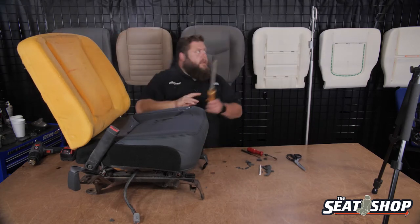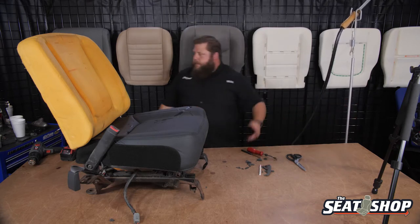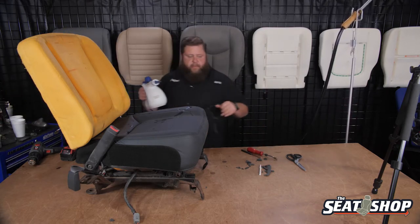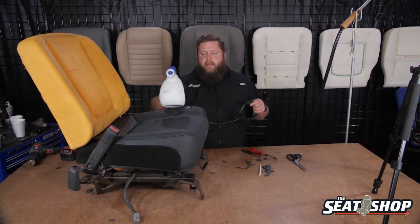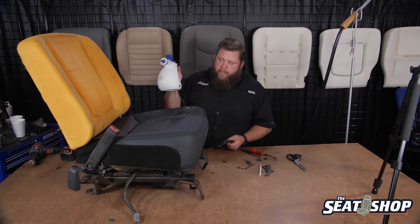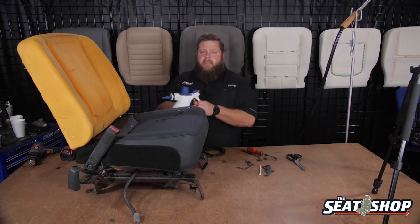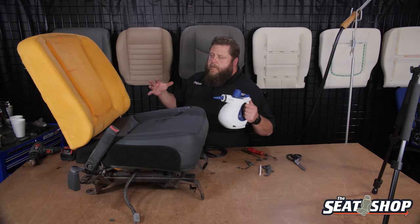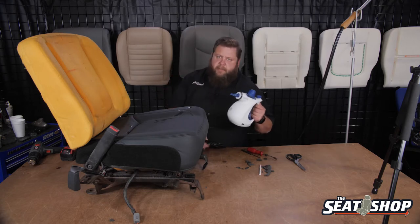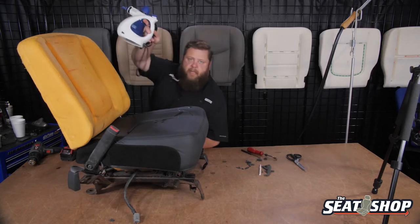That's been pretty good — we'll set the steam to the side. If you don't have a big steamer like that, it would be kind of odd for a regular household to have one. A little hand steamer, a garment steamer — about 20 bucks on Amazon — takes about two minutes to heat up. You can fill it up, steam through, then fill again, and probably get enough to do the top and the bottom foam. The steam makes a really big difference — having the steam to steam out the cushion before you put the cover on so it's swelled back up. Get a steamer, it's really cheap and it makes a massive difference on your install.